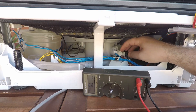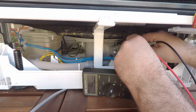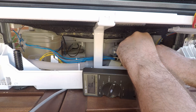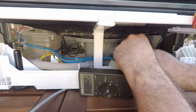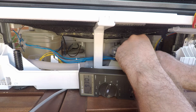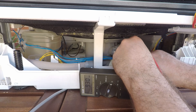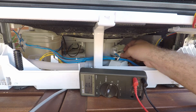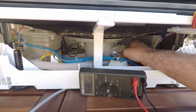There's also what looks like a sensor, judging by the thinner wires. The outermost pins on this connector are about 18.6 kilo-ohms, and both outer pins to the middle pin are about 9.3 kilo-ohms. If you're not getting those values, you may need to replace the heater itself.